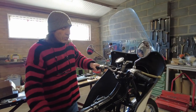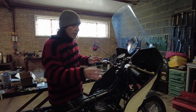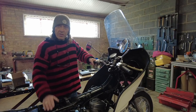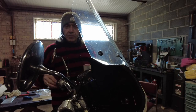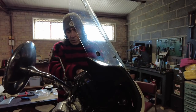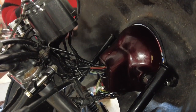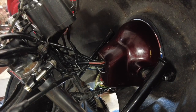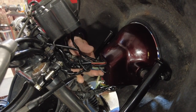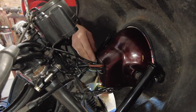For this session, I've put the fairing back on. While the fairing was off, I had a look at the electrics - we're going to start doing the electrics next: indicators, headlamp wiring, and all that. While the fairing was off doing the lock stop repair, I decided to have another look at the wiring we'd already done. We had big block connectors up here and it looked really awful - there's no way Rickman did it that untidy. So I unplugged it all and fed the bottom big main wiring loom in the bottom, and this cluster that comes out the clocks at the top for all the warning lights and switchgear - I put that in there and managed to connect up the big blocks inside. It's just long enough.